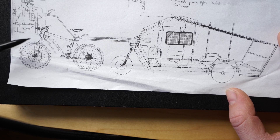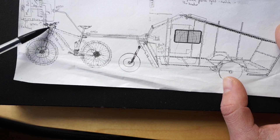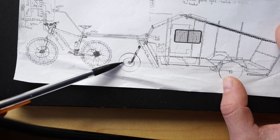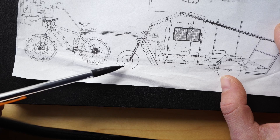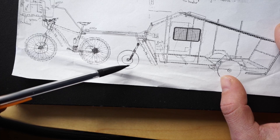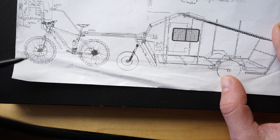The second way — and this is what I'm going to try — is to run them independently. I've bought two cycle analysts that I'm going to mount on my handlebars using a 3D-printed mounting plate. On the left I'll have a twist-grip throttle controlling the rear hub motor, and on the right a twist-grip throttle controlling the front motor. I'll have trip wires controlling regen braking to each motor independently. The reason I want to try this is because when I tested controlling both with just one cycle analyst, on looser terrain the power distribution wasn't effective — it would send more power to the wheel spinning out on loose gravel rather than adapting. With separate inputs, I can control how much power goes to each wheel, giving me better overall control.